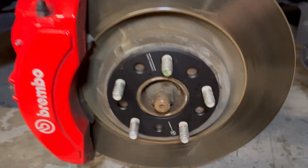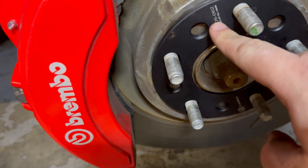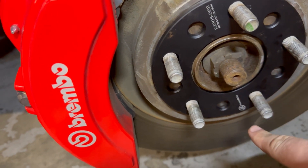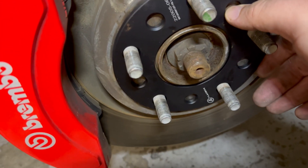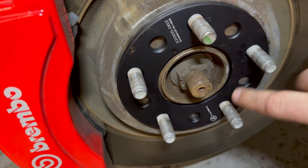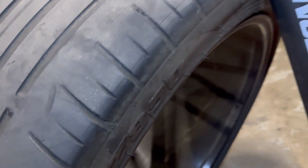The spacer is on. On this device the lettering faces out and the tapered end goes to the inside — you want to see the brand name facing outward. It is hub-centric, and other than a little give to help you get it on and off, this thing is solid — goes right in with no movement at all. I also cleaned up the inside of the inner hub with a grinder, so it's nice and clean.